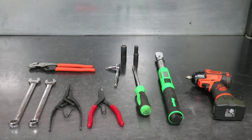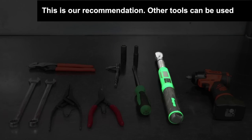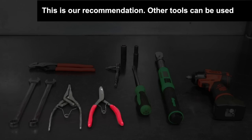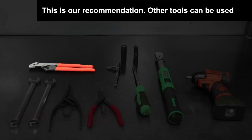Some tools you'll need for the job include a 3/8 drive impact, battery or air powered, a 3/8 drive torque wrench, a long flat head screwdriver, two deep well impact sockets — one 10 millimeter and one 15 millimeter — one quarter drive ratchet with a T15 torx drive, one or two snap ring pliers. You'll also need an 18 millimeter wrench, a 19 millimeter wrench, and some channel lock pliers.